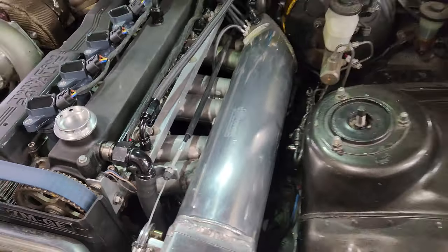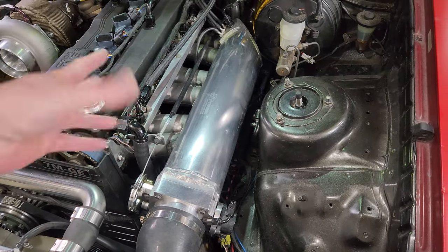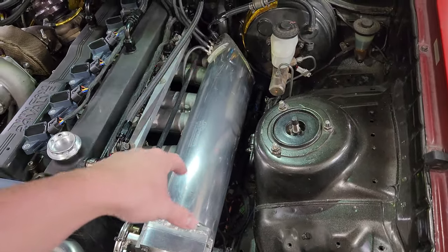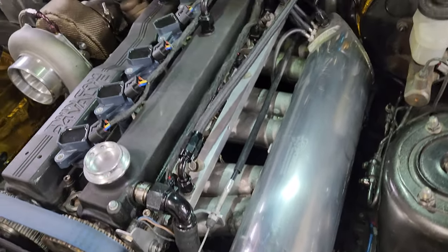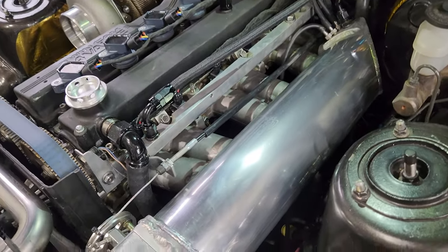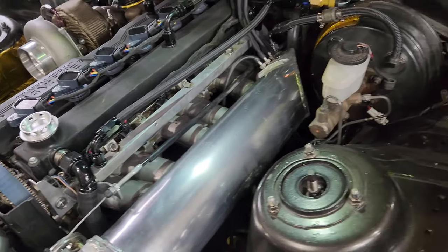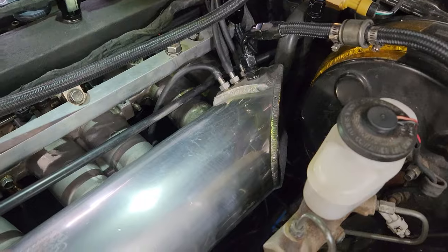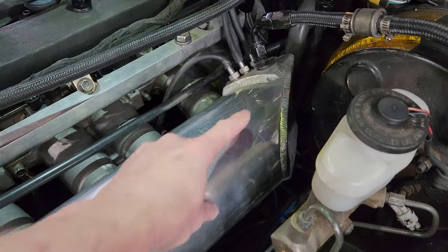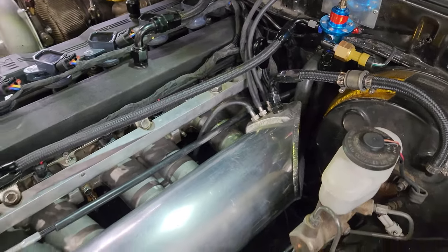I couldn't move it too much forward or back because I wanted all the preexisting holes to match up with the runners. Each hole lines up perfect — they were a little bit off, but after we welded these on, we went in with the carbide bit and opened them up. I just used the bottom runners — the lower runners — and that was it. I didn't have to fabricate or change anything on this part. It just bolts right to the motor. We bolted those on, set this on here, placed it where we wanted, tacked it in place. You can see it's within a couple inches of the brake booster, not even close to the firewall.